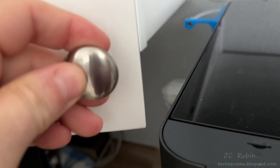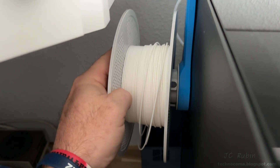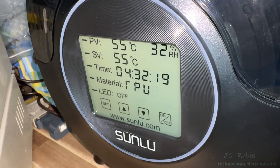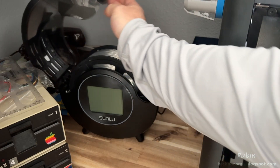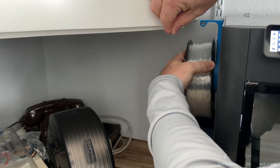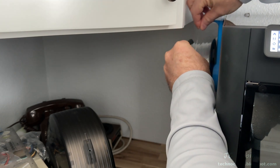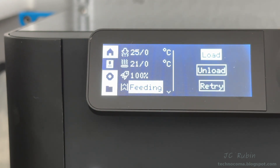Skipping ahead, I check that the enclosure door just barely clears the printer — that's how I always position it — and slap on a roll to confirm it clears the poop container and other obstructions. Looks good. My TPU is drying, and ironically I could have used the dryer unit itself as the spool holder for this new setup. Eventually we're ready to go for the first print. The spool diameter turns out to be too large for the spool holder, so I'll keep it elevated to feed from above and use the load filament menu to load it.